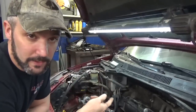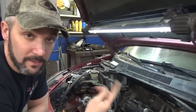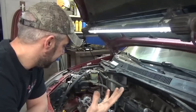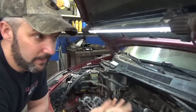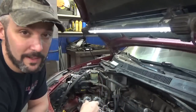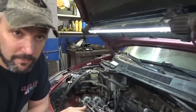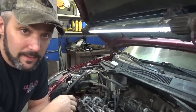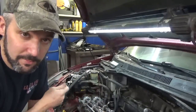Because once you roll it over, you can't rely on those gold marks and the orange mark anymore until, I don't know how many times you'd have to roll it over in order for them to be realigned. So if you're wondering, did it stay? Did something move? Well, just make yourself a few marks. The marks are really kind of redundant. You can essentially put them anywhere that is easy for you to reference, because it should come back to any given point wherever you make your marks. So if you're just double checking to make sure things stayed.